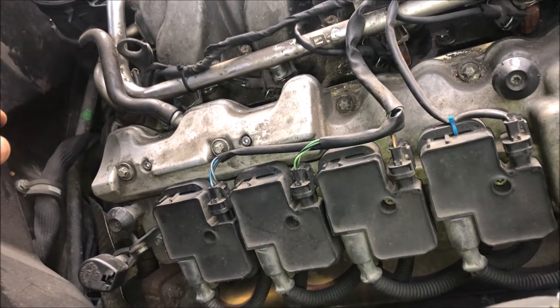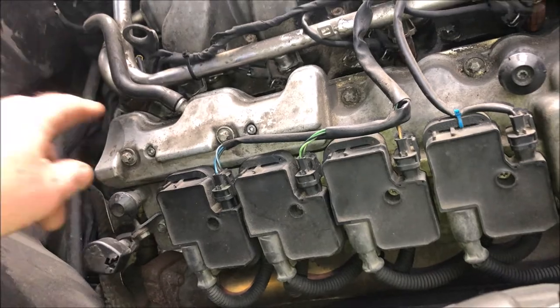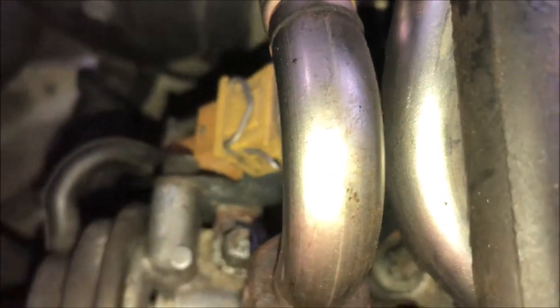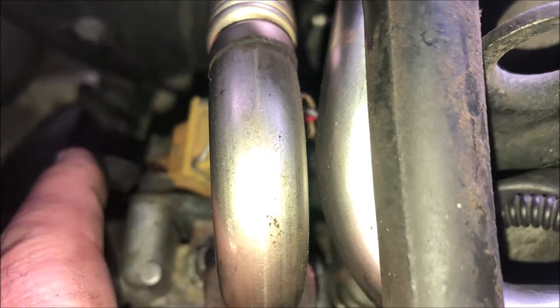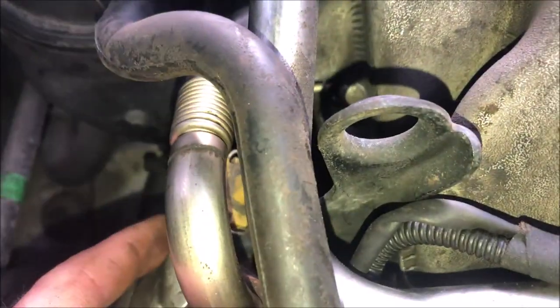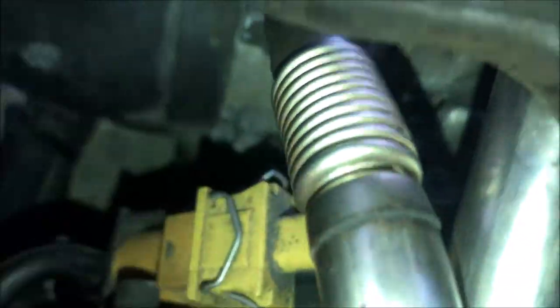so I'm assuming it's the electronic solenoid. So let's unbolt that. There should be a T14 like that on the back right there. That holds it in, and then there's, oh god, it's an Allen key. I think it's a 6mm Allen key, but I'll let you know in 2 seconds. So that's it, that little bolt, and then this one here, and then unplug this, which is done by simply squeezing the metal.